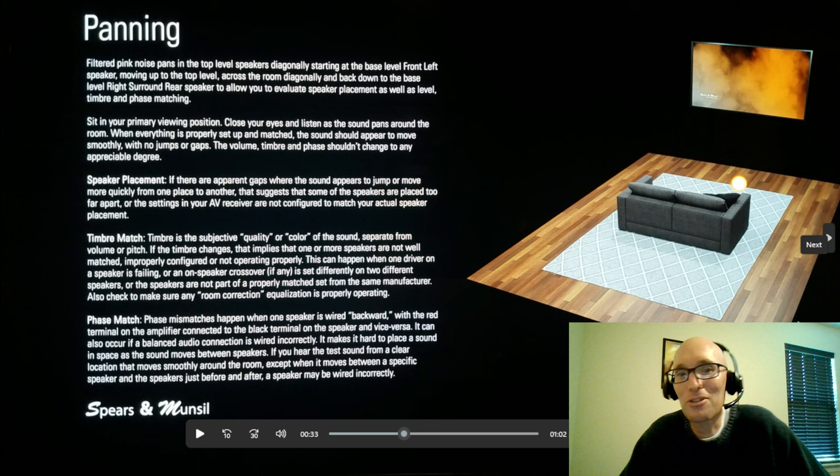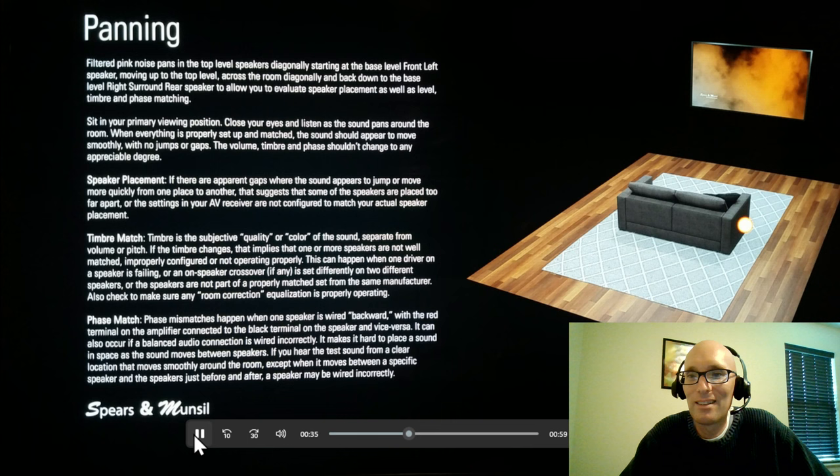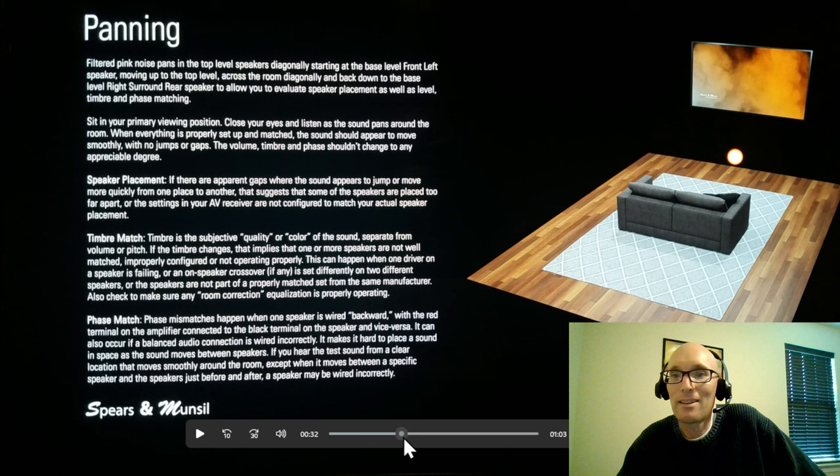So now it's coming down. And now we're in the back surround right speaker. And here was half a dB low as well. So again, this transition now between the front and the surround, I think I did it again about three different times, slowly making minor incremental changes. But this sound going across here was 100% the same volume the entire way down.